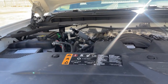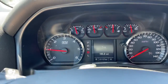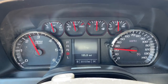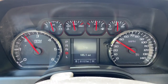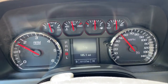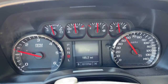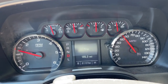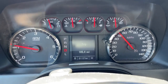I'm going to let it do its thing for a little bit longer. Then we'll get it onto the ground, verify the level, and take it on a road test. I noticed a marked difference after putting about 100 miles on it. That 2-3 shift is a lot smoother now, and that's where I was really noticing most of the issue. I think if I get another couple years out of this transmission with this Lucas in it, that's a good enough deal for me, to be honest.